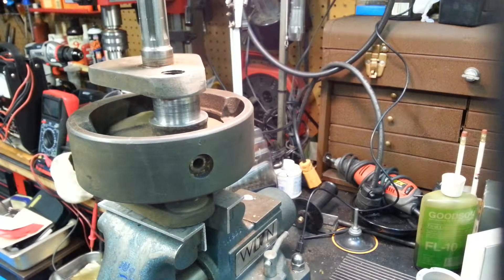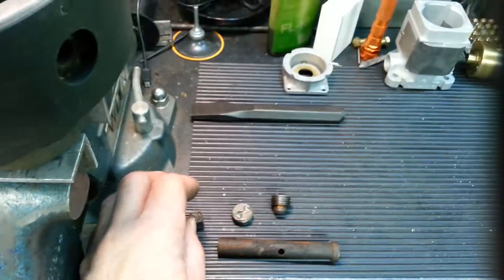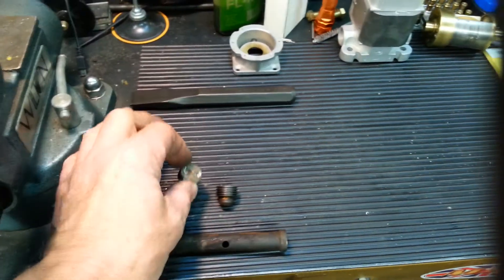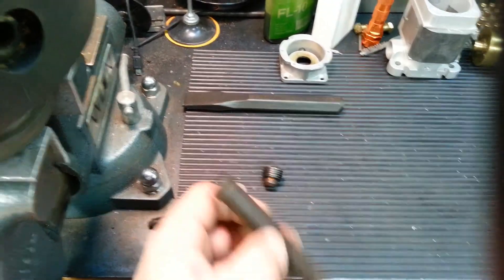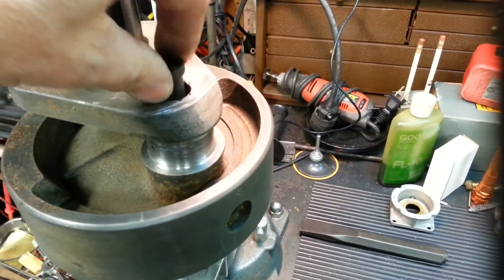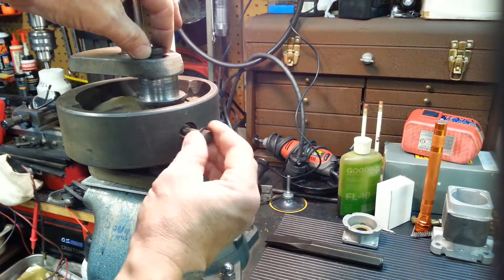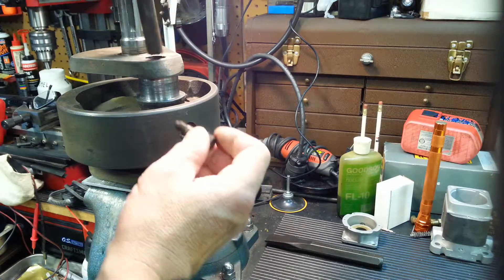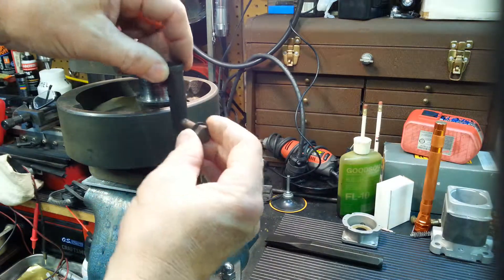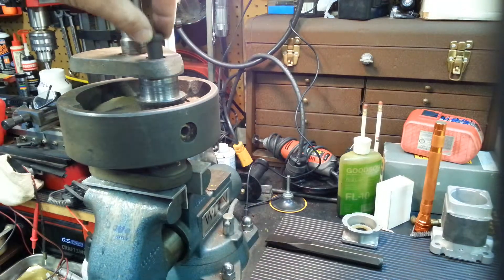We're back with the A-10 Super Rocket crankshaft. I did remove the two plugs on each end — as you can see, they were a hassle to take out. I slid out the sludge trap, which came right out of this hole. In order to slide the sludge trap out, you have to remove this bolt in the side — the bolt that's in line with the two journals — because this bolt fits inside the hole and holds the sludge trap securely inside.